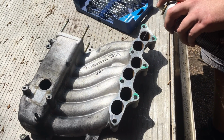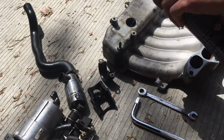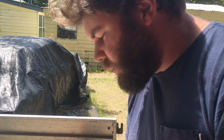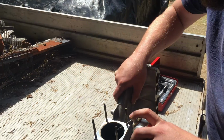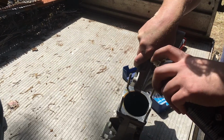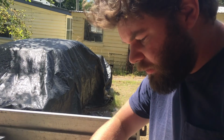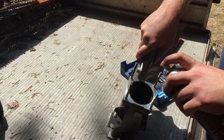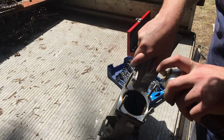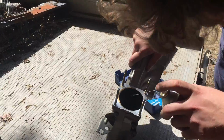This is what happens when you overheat your engine, I guess. Well, we still haven't really decided what caused the failure, but I would say it just overheated, given it had a coolant leak anyway. And I think the coolant leak actually led to one of the valve guides pinching the valve, which held it open, and it got smashed that way, because the belt looks like it's still in the right spot, and that's what usually goes with these engines. Yeah, fun.